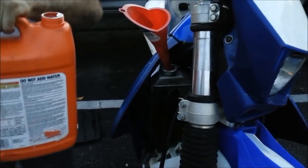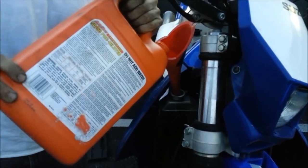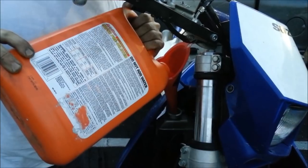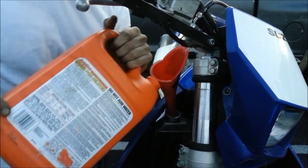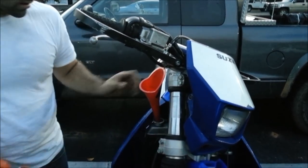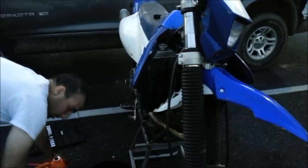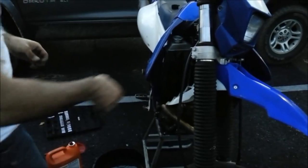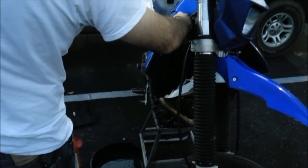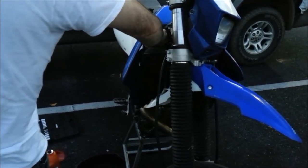Just take it easy with it. When you see it start to overflow, slow it down and just keep on filling. The level will fluctuate because it's got to get into the radiator. That's about as full as it's going to go — it's going down through the overflow hose. So now what you want to do is cap this up temporarily and then run the bike. Heat it up and run through a heat cycle.